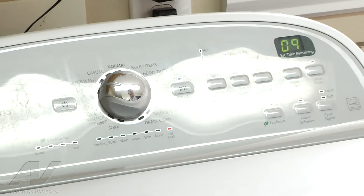We're still continuing our test mode here. It's going to try to agitate. A lot of times you hear a faint click, and then you should hear the machine start to agitate. Now it's draining the water out. After it's done draining, we'll hear another faint click. Possibly if the pump's on we probably won't hear it, and then it'll go ahead and start the spin portion of the cycle.